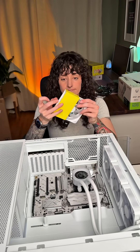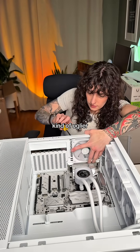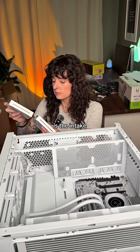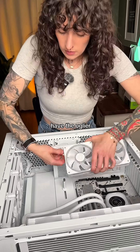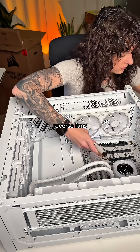Now you take off his undies. Typically on a PC case fan, the side that's kind of uglier and has more plastic on it is the exhaust side, and then the pretty side is the intake. So since air comes out the uglier side, if you want intake, you're going to have the uglier side facing in. But this does not apply to reverse fans.